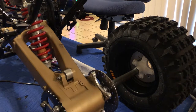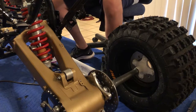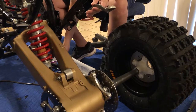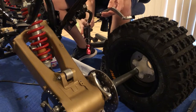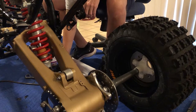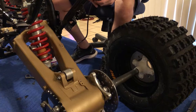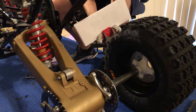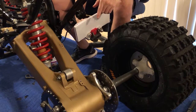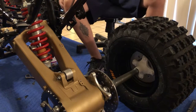All right, let's mount up some rear brakes. We're gonna put on the caliper first, then the master cylinder and brake lever. We have the brake lever, the rebuilt master cylinder, and our freshly rebuilt caliper. I found a nice use for junk mail - keeping the brake pads separated so we can put them right over the rotor. Without further ado, let's do this.